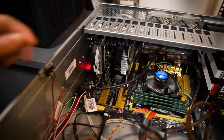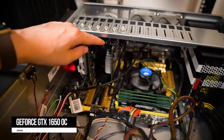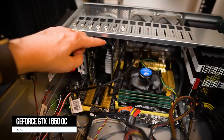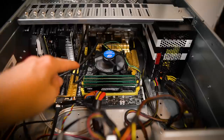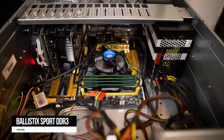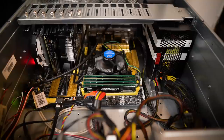Now that Mixer isn't around anymore, I'll figure out something to do with that card. On the right is the Zotac Gaming GeForce GTX 1650 overclocked — also no external power — using the newer Turing architecture NVENC encoder. This one runs my Twitch stream, which is a 24-hour always-on stream. Both cards draw all the power they need from the PCIe slots. I have 32 GB of DDR3 RAM, which is all I need since this server only runs two virtual machines — each gets a video card passed through and 12 GB of RAM assigned. This is my second Proxmox server.